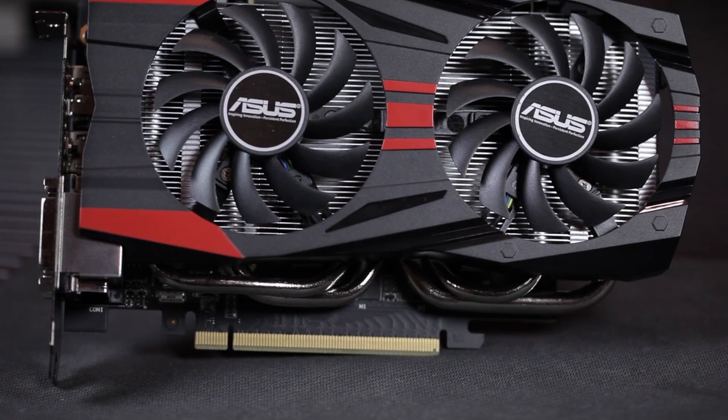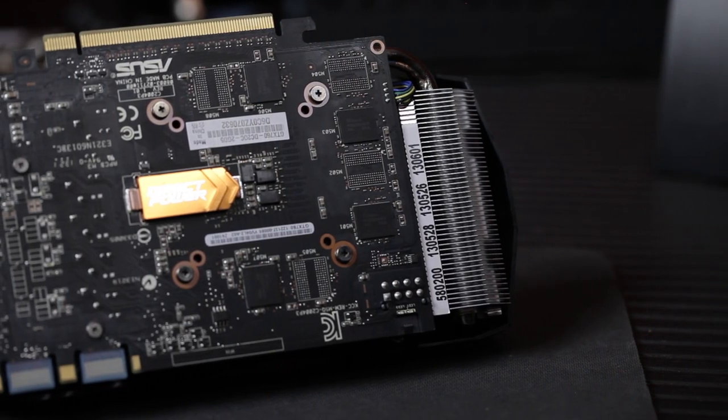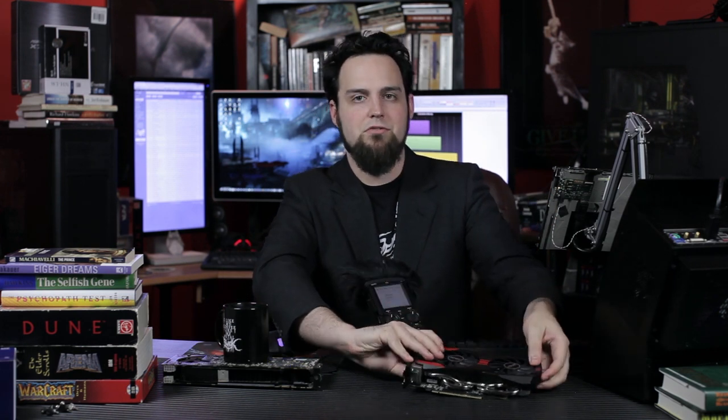A lot of people are putting this up against the GTX 670 because it's sort of a replacement — it's very similar to that card. It has more memory bandwidth but not quite as much of everything else. In our benchmarks, this is actually a slight bit faster than the 670 at 1440p in most games, but usually 1 to 5 frames per second slower at 1080p. But the price is so much lower — this is a much better buy. Asus does have the 670 Direct CU 2 Mini if you need something smaller. My money's going to the 760 though. It's a beast for 1440p in most games, and if you have a 1080p game with lots of filters, the 760 is going to be faster.